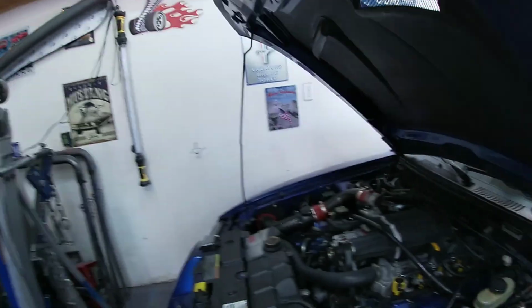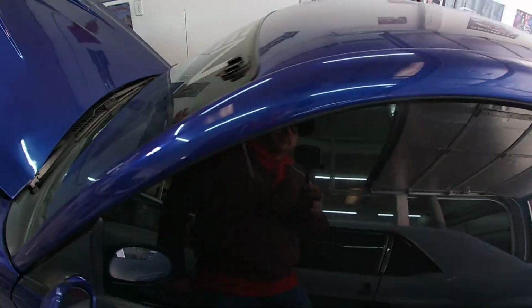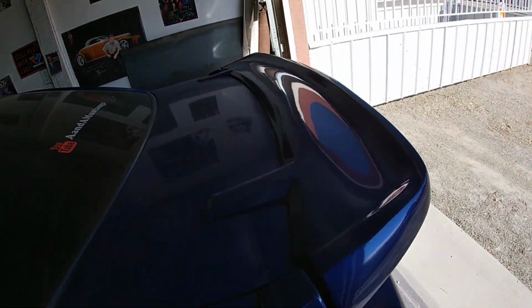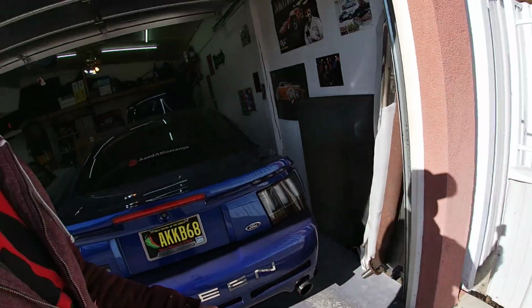Extra bonus clip. Everything's good, no leaks. I was able to take the car for a drive now, and it seems like it's running good. When I stepped on it and it was under boost, it was running about 13 to 1. So I think those injectors are gonna work, so we'll see. I'll probably take it to the track again once they open and let her eat, see what happens. But thank you for watching.